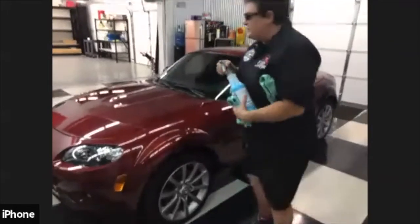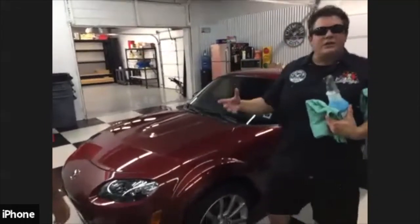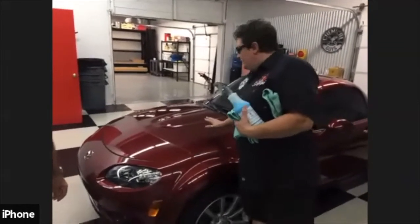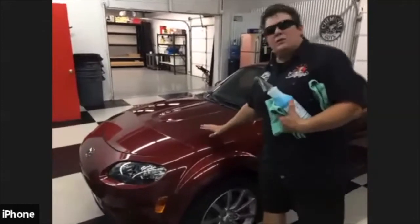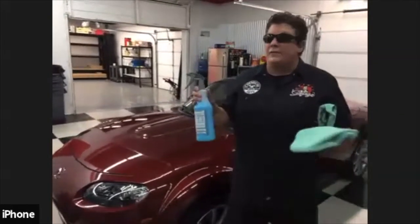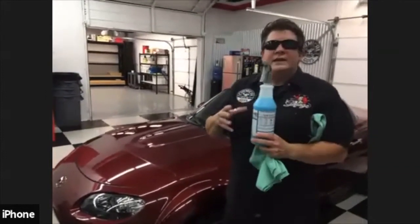The first thing is, you definitely want to make sure that you're not doing this in the sun. Doing it in a shaded or cool area is more beneficial, and you want to make sure that the surface isn't too hot. Now, Steve pulled in probably about 45 minutes ago. It's a little warm, but it's not too hot. The reason is you don't want your waterless wash to dry on the car, because obviously it's not going to clean the car.